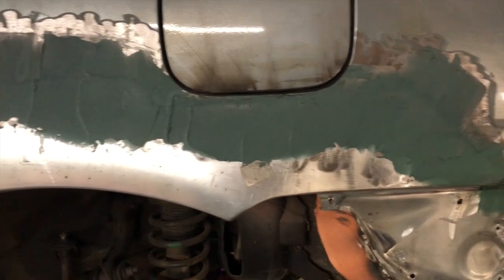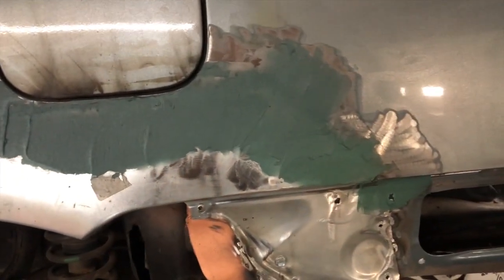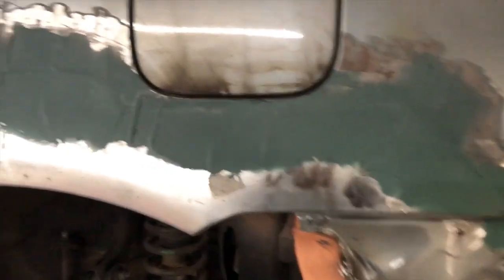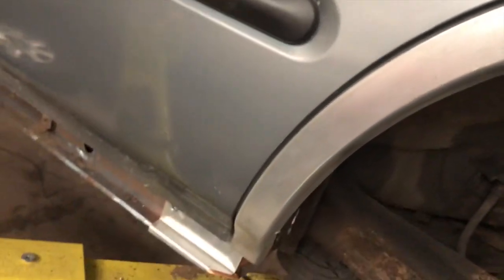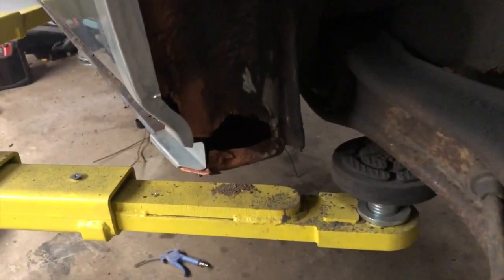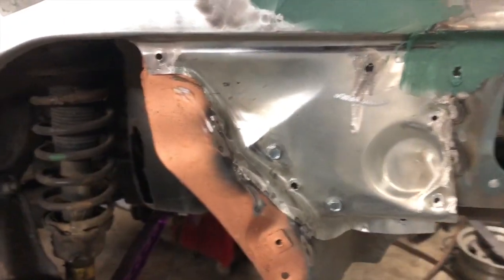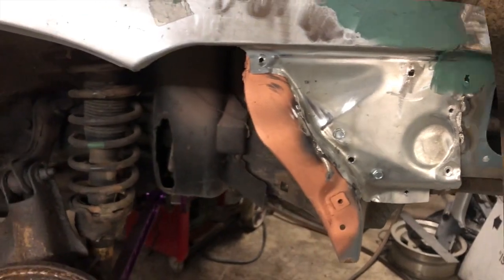For now it waterproofs my welds. I might get energetic, but I don't want to do anything until I can weld that door shut because that whole body line has to be welded up all the way to there. So one side down — I still got to patch that hole inside, which I'll do now. And then this side will be done. I'll trim down here, cut across, weld it up solid, bang it in — and this side's done and the bumper can go back on.